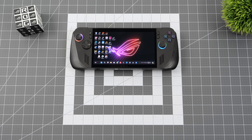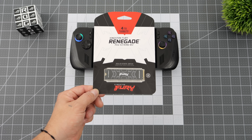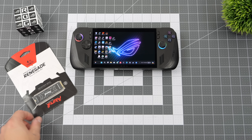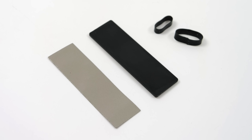In order to upgrade the storage here you will need a much larger drive. I opted to use the Kingston Fury Renegade — it's a four terabyte PCIe 4.0 drive. These things are super quick and I use the smaller ones in a lot of my PC builds. I also picked up a heat sink just in case we can fit it in the Ally X, along with a flat heat sink and a sticky heat shield that'll go on the back side of the SSD. I'll leave links in the description to everything I'm using.